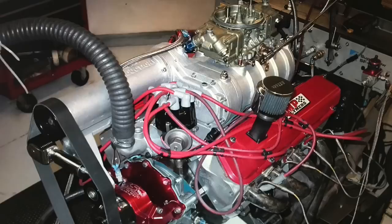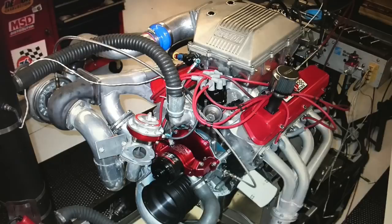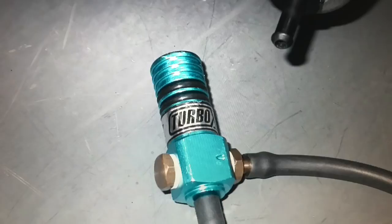But don't discount that roots blower - it had the best low speed boost response. A centrifugal makes good power at the top but lacks boost response down low. With the turbo, you've got to wait for it to come on, then it's really good - but you have to juggle boost response versus turbo sizing. They all have their pluses and minuses, and unfortunately there was no way to get the boost identical on all combinations since we just didn't have all the pulley ratios. This test shows what they all do, and that's what we were trying to do.